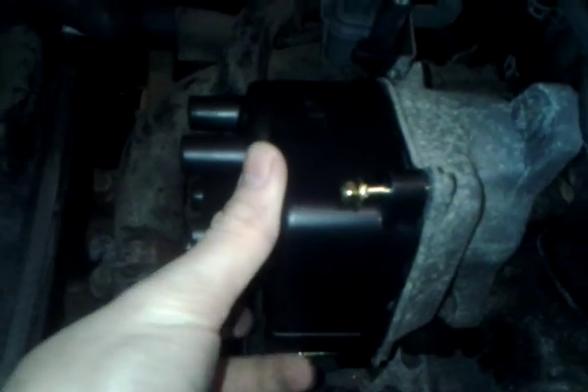Now, quick tip when you're doing this: you'll notice I don't have my new cap on yet — my old cap is still attached to the spark plug wires, and there's a good reason for that. So I don't lose which wires go where. When I put the new cap on, all I've got to do is line up the old cap with the new cap and take one wire at a time and move it over. That's the easiest way to not screw up the firing order. Anyway guys, hope that helps some of you out. Make sure to hit like and subscribe — we're always doing projects in the garage and talking about cars. Thanks for watching!